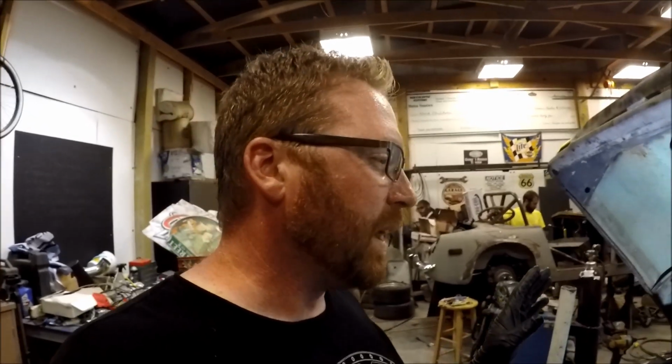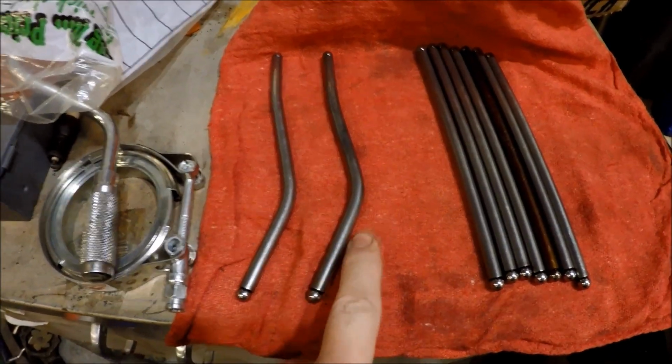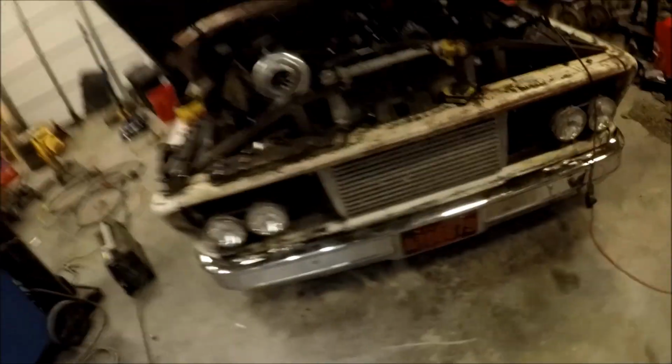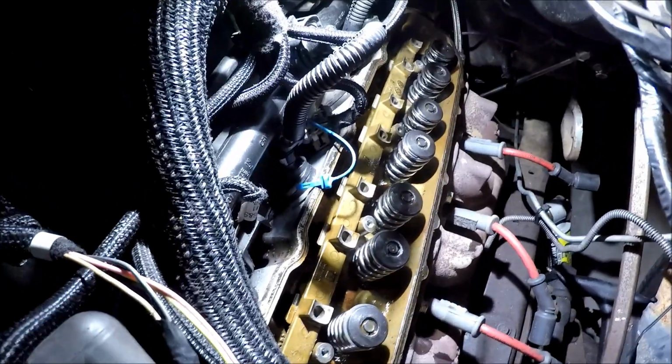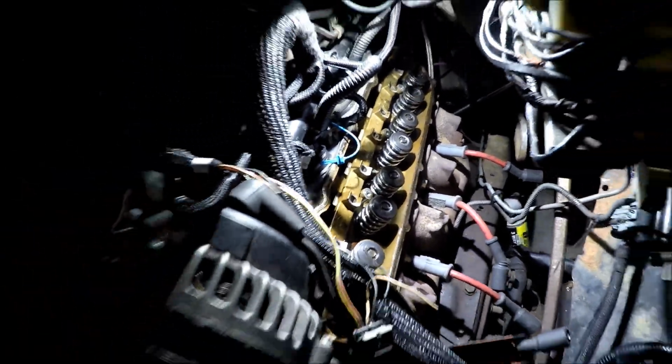So it's not raining tomorrow. I'm gonna ease it to work and back and see if they get rattly, if we're out of boost, and see what happens there. So number 7 cylinder, number 1 cylinder. Don't know what's going on. We've got everything pulled off now. Got rockers off. I am ordering new retainers tomorrow with new locks, and we'll see if maybe that will fix it.